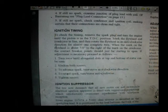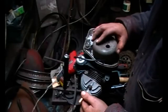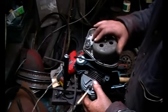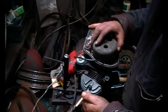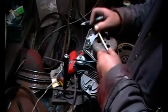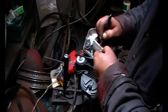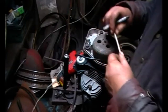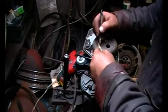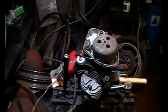Now there are the instructions for the timing, which I have never had any success with, so this is how I do it. With the flywheel in place, I bring the piston up to top dead center using what they call a coffee stirring stick — the little wooden stick you get for stirring coffee. I insert it into the plug hole, turn the engine over until I find top dead center, and then mark it with the top fin as an indicator of where TDC is on the engine.